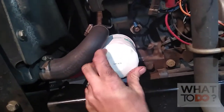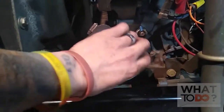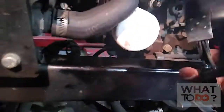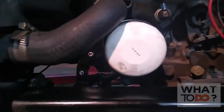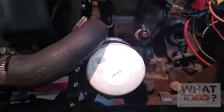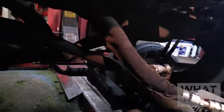I'm not sure if this is the same size as the Napa filter or not, so that might affect whether we can get the wrench back in there to tighten this up — but we're gonna find out. Looks like we'll have the clearance. Just get this as tight as you can by hand; you don't want these super tight anyway. I normally put it on and then give it like two nudges with the oil filter wrench — let's see if we can get this under here. There we go, just like that. One, two, a couple more, three, four — and one more for good luck. Should be good there — filter's back on. I put the oil pan screw back in and got the old oil out of here.